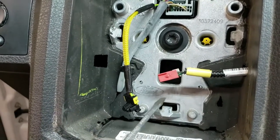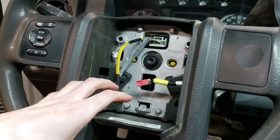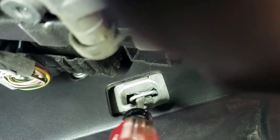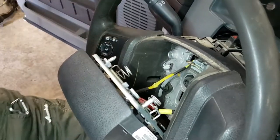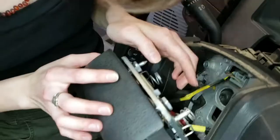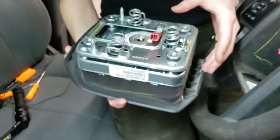From the back end you're pushing the clips off like this. What I found most useful was getting the two easiest clips off first, then pulling the panel out enough that it stays on its own, then getting behind the harder-to-reach one so it all pops off. I've got a screwdriver stuck in between the hook and what it holds onto. I'm going to sit away from the airbag — even though the battery isn't plugged in, I'm paranoid — so my body isn't directly in the path if it deploys. Then we unplug this connector and that one, pinching to give a little slack and pulling out.